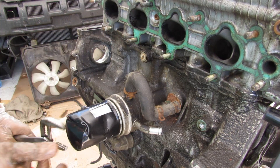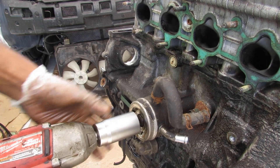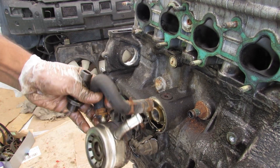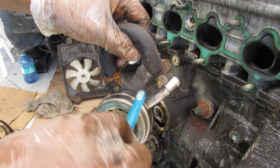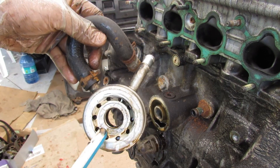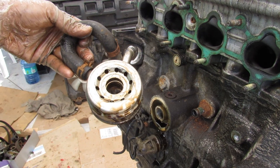Using a 30mm axle nut socket as an oil filter removal tool — no oil, I love it. Removing this fitting and the oil cooler: oil goes inside from one side, and around it there is a coolant jacket that comes from the coolant pipe to cool it off. I also have another video on how the cooling system works in your engine, so check that out linked above.